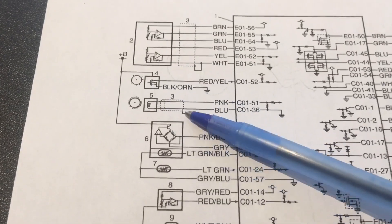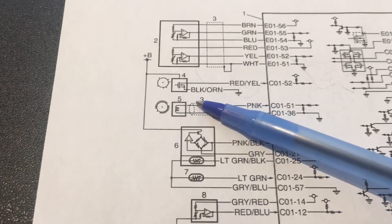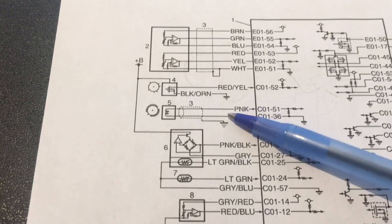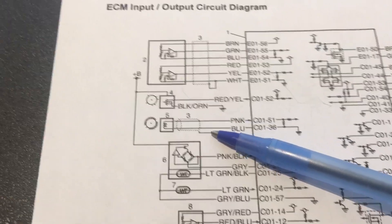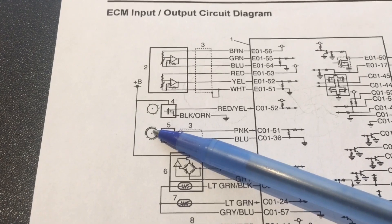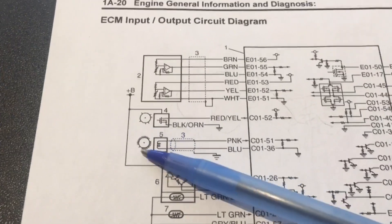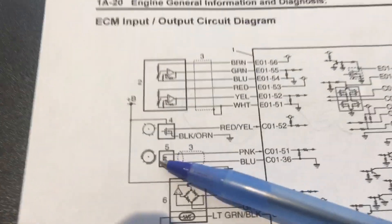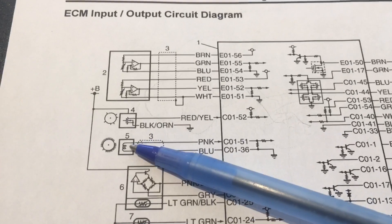As you can see from the drawing, there is no such supply to the crank sensor, so we can be relatively sure it's just an induction type sensor that generates its own small AC voltage, and from that they can derive the rotation of the crank. There are a couple of indexes on the rotor — the crankshaft position sensor plate as they refer to it in the manual — essentially a reluctor wheel or trigger wheel.